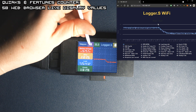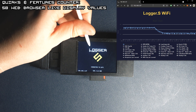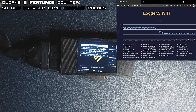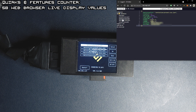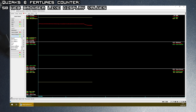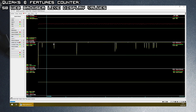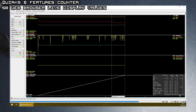Let's go back to SD Card Explorer and take a look at the file we got. Once we restart the device and refresh our browser, we'll see a new file created by the autologging feature. When you right-click and download the file, we will open it in Megalog Viewer HD. The prepared file is dense because it has 33.3 data rate per second, which is responses per second shown as rps. At the end of the file, you can see there is a 5-second delay after the value went below the threshold.